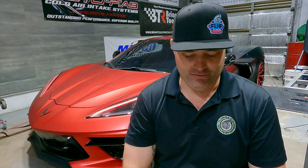Keep in mind, this car baselined at 422 horsepower and 415 foot-pounds of torque, and it is now making 461 horsepower and 455 foot-pounds of torque at the wheel. Again, naturally aspirated, bolt-on car — drive this thing every day — and now he has the pleasure of being able to switch between 93 and E85. He could even mix it if he wanted to, run something like E50, although I wouldn't — I would either run one or the other. The system now has a flex fuel sensor, we have the monitor of the alcohol content, and timing will change according to that content and the intake air temps. Overall, very pleased with the results.